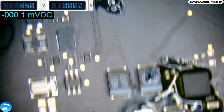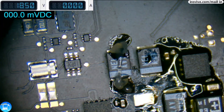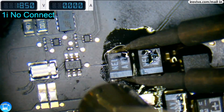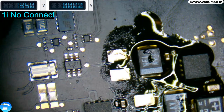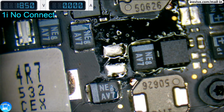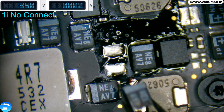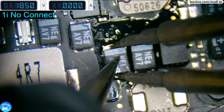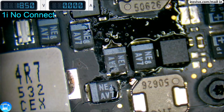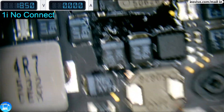That's going to be this specific capacitor. We got a replacement capacitor - let's go ahead and solder it back onto our patient board. We got our capacitor completely replaced. Now we just need to verify that it's still booting up, then we'll call it a day on this one and give it an ultrasonic cleaning.